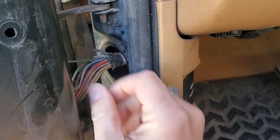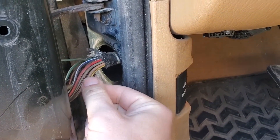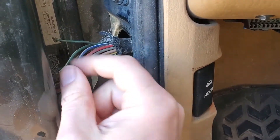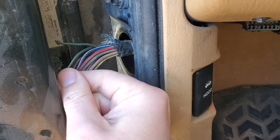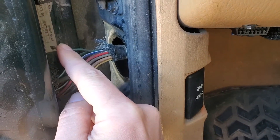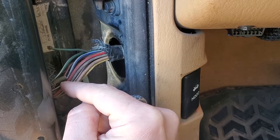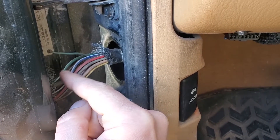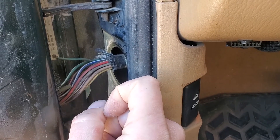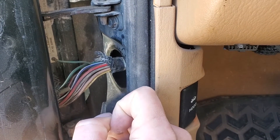And then there's a wire loom that this is in — you just cut that. You can see it right here. And you can see this is my problem right here: this wire and this wire used to be one wire. So all you've got to do is use a wire nut or maybe solder in a little section of wire there, and your speaker will work again.